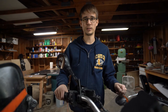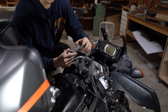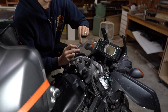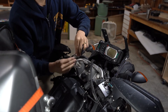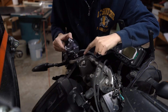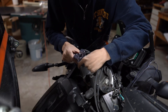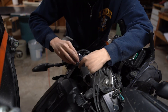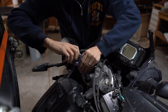Now we should be able to start installing the risers. Note that the caps are not equal — they're a little bit taller on one side. There's a small dot underneath one bolt: that dot goes forward when you put these on. Tighten the front cap down first, then set your tension with the rear cap. If you put both caps on flat, the risers won't clear the bolts, giving only a couple degrees of adjustment. You can cock them back and access the rear bolt through the access hole in the riser — a nice detail they thought of.